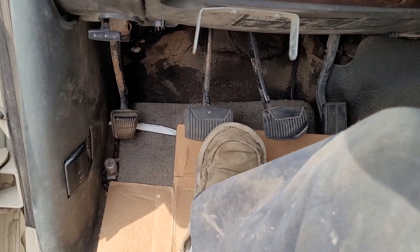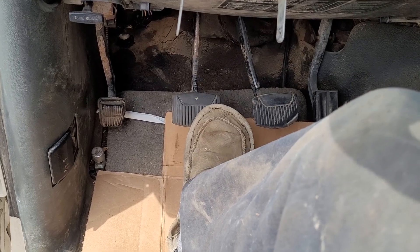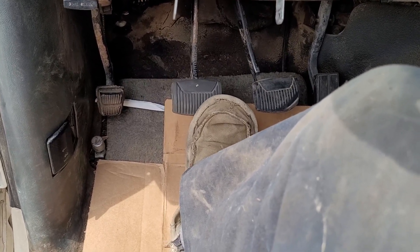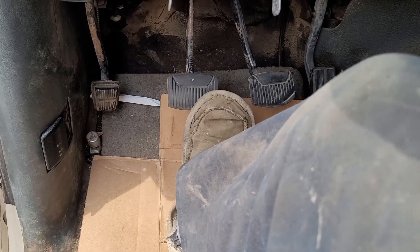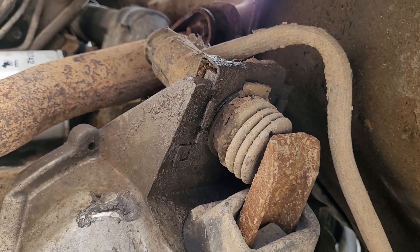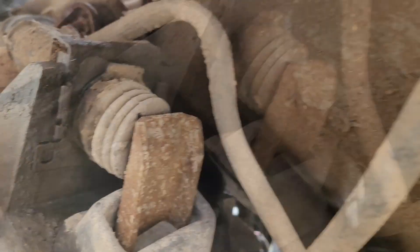We can give it a try - it'll be an improvement at least. There is some slop in that bushing but it's not a catastrophic failure like you'll see when it really causes problems. What we'll do is have somebody press the clutch pedal just to where the dead space stops, go under the truck and look at the slave cylinder - if it's moving we probably have a worn out clutch, but if it's not moving then we have air in the system or a failed master, because the piston is moving but not doing anything for the first two inches. Go ahead, are you doing it? Okay, so we've either got air in the system or the master has issues.